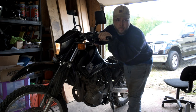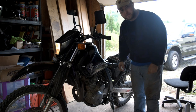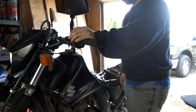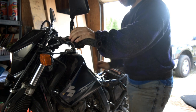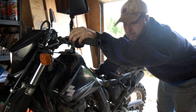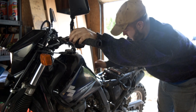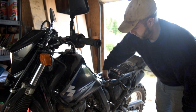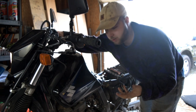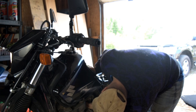Remember we have to pull up that float bowl. I just almost put the choke up and it sounded like it wanted to die, so we might not have enough fuel. I turned the choke all the way off and the bike wants to die, so we're going to have to come out more than our two turns.